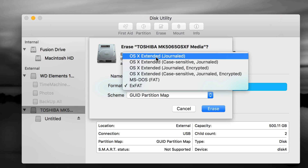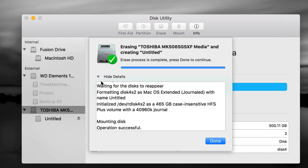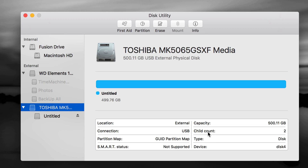Right now we're going to do partitions and set up Time Machine. Time Machine is the best — it's going to back up your entire computer including photos, videos, any file you have, plus all your installed apps and settings. We're going to format it first as Journaled and then make it compatible with both Mac and PC. So let's press Erase. Your external hard drive shouldn't take this long — mine's an older 500 GB one. Even with one or two terabytes it should only take a couple of seconds.